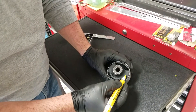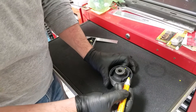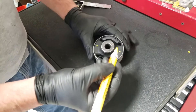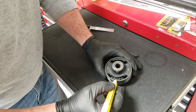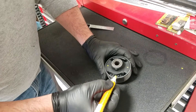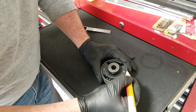The OEM ones come with these little arrows, and I notice that the aftermarket ones do not. So I'm going to highlight these arrows because they're going to be really important — you'll see in the next move. So you see the arrow? Let's do the same here. I also want to mark a third point so there's no confusion in the orientation — you could be 180 degrees out of phase. If you have three versus two, just three points: if you line up those three points, you're going to be in good shape.